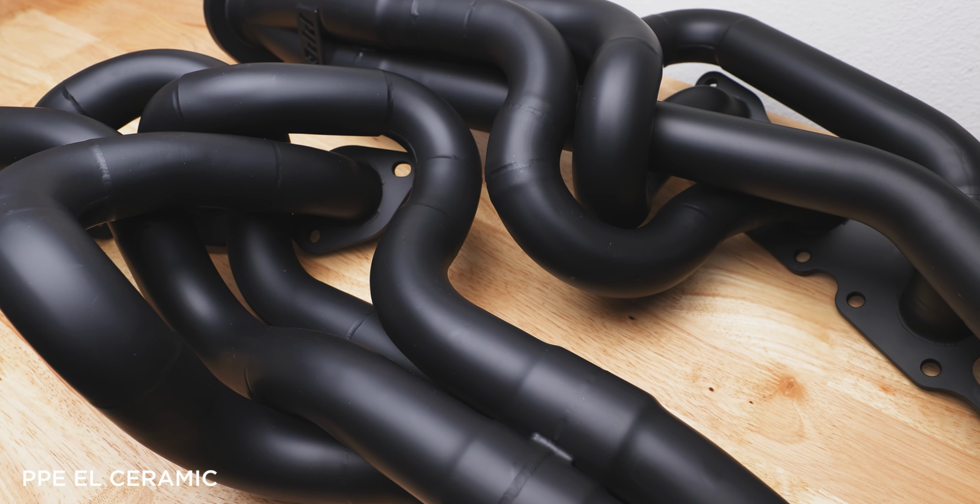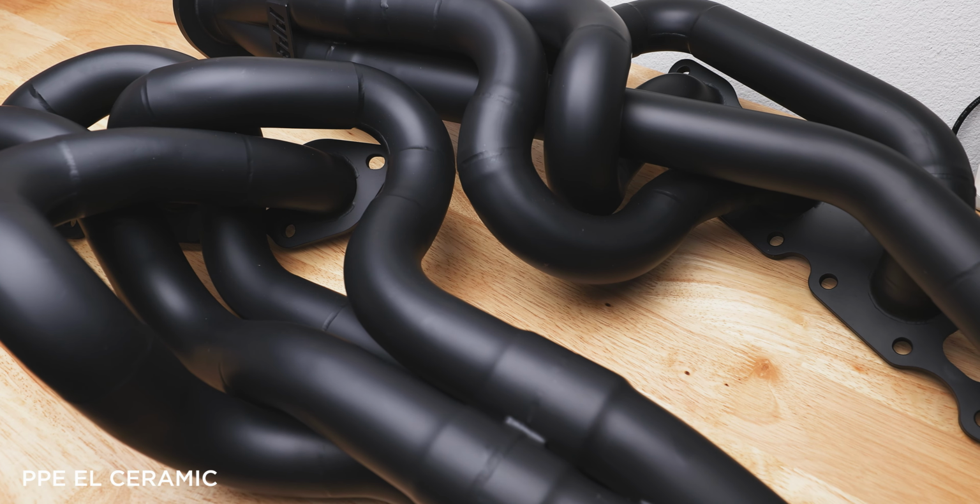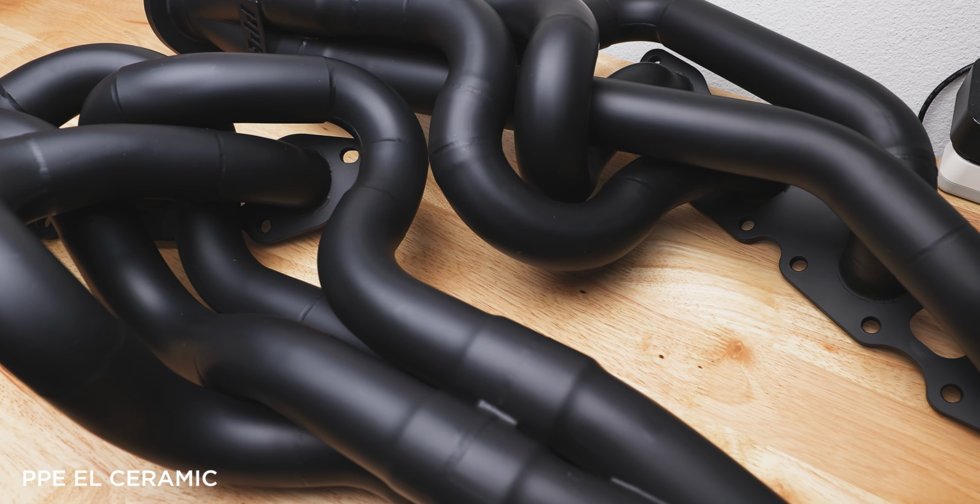When it comes to producing horsepower, most builders go with full bolt-on mods. When you're reading on the forums or the groups, you might see the letters FBO, which means full bolt-ons. This signifies that the person has all the standard bolt-on upgrades for their car, which usually consists of an exhaust manifold or header, a catback exhaust, and an intake of some kind.